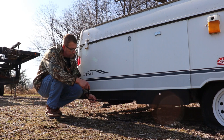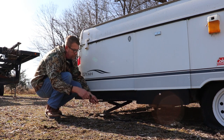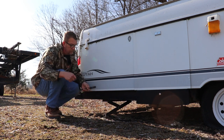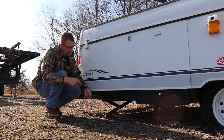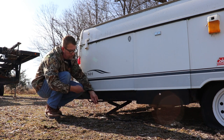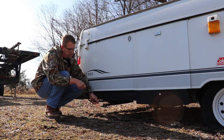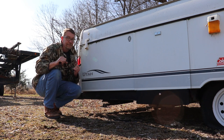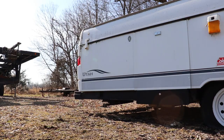Level the trailer. Using your crank handle, jack handle, or cordless drill adapter, lower the jack arm until the jack is firmly on the ground. Using your crank handle, jack handle, or cordless drill adapter, raise the jack arm until it is up. With a crank or jack handle, bump the jack to close it tightly — typically just about an eighth of a turn more. This locks the jack into stored position and helps prevent it from lowering during travel.